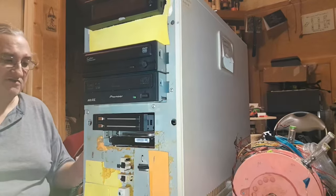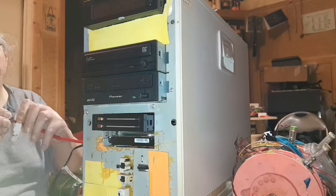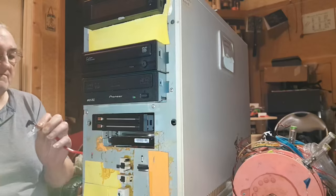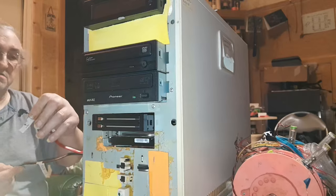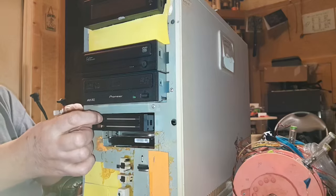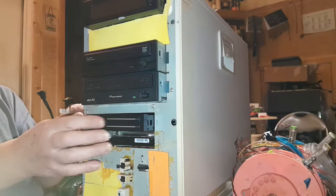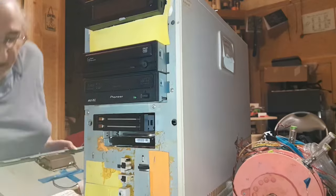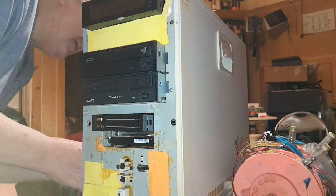Right, so I want to bring the camera back over here, but it's still charging up. So what I've got to do is, oh look, it's coming up again, look. So this one can go back into SATA number one, because that's going to stay in now. The other ones are going to stay out until I'm ready for them. But SATA 6 can go up into the SATA 6 socket, because that's for the other drive. There's nothing in it, so I can put SATA 6 and SATA 1 in, but I can leave the rest out. Anyway, that's where I'm at the moment. SATA 1.